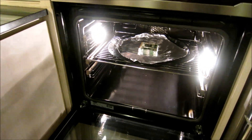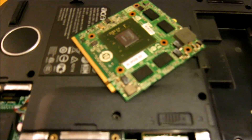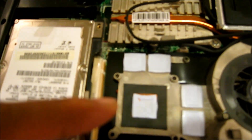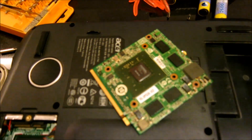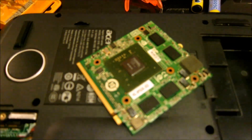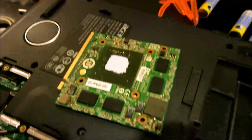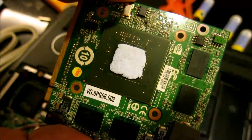The GPU has cooled down. What we're going to do is take the thermal paste and put it back onto the GPU, then reinstall the card and see how it goes. We've let it cool down for about 40 minutes now and it's stone cold again, so it's all ready to go. I didn't have any thermal paste, so I've reused what was there and put it back onto the chip, covering it in its entirety.